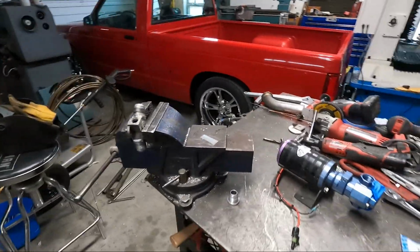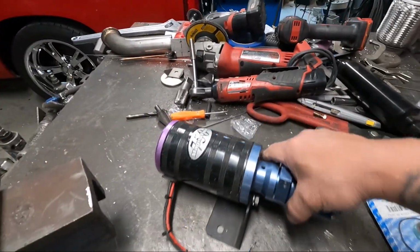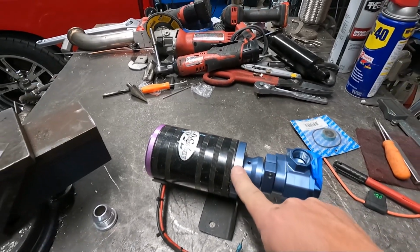And that means, actually, I'll show you the other part of that. I don't think I showed it in the earlier part. So I have one of these fuel pumps on the car already, and it had a small one, like an AEM 400 or something like that, it ran on for low demand, driving around, things like that, and then the big pump turned on. Now, one of the big pumps is going to turn on for low demand, and then when the throttle goes above a certain percentage, the second one turns on, and then the magic happens.